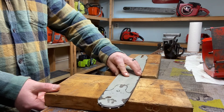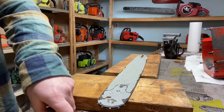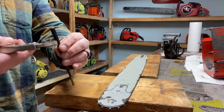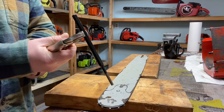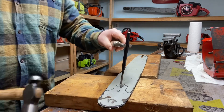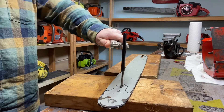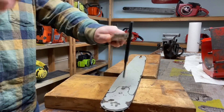Here I've got my blocks of wood, and I have a hole drilled in one of them. My hope is to drive the rivet down through the hole. I've got a punch and a set of vice grips to hold the punch with, so I can keep my hand out of the way. I don't know if you've ever hit yourself with a ball-peen hammer, but it does not feel good. So here's a little trick.